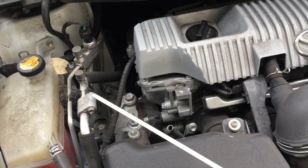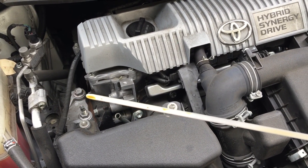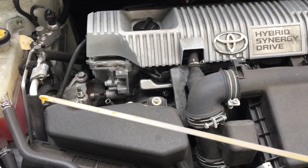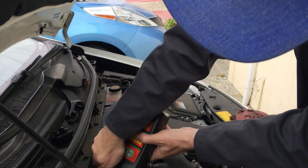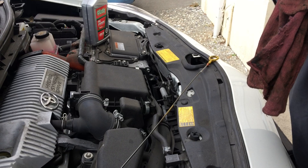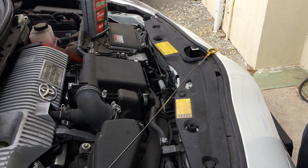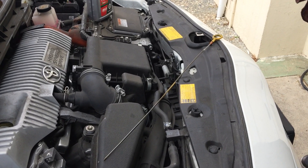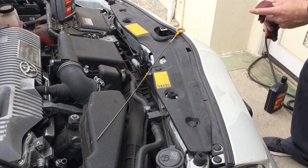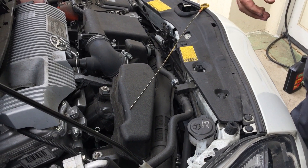We've finished our battery clean out, and general best practice — check the fluids. That might appear to be just a little low, but that's what you call off the stick. So we're gonna add and see how low this car really is on oil. I'm gonna pour in a quart and we'll see if that brings it up to level. It turned out the oil was a full two quarts low. So it was really good that we did that last step after our battery fan clean out procedure and actually checked the oil, because we probably saved the engine on this car. If the owner had continued to drive for a long amount of time with all that oil missing, that would have been the end of that engine. So all in all we did a good job and saved the customer quite a bit of money on the potential for engine damage.